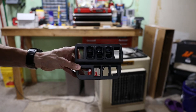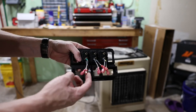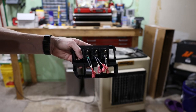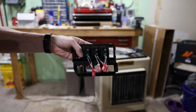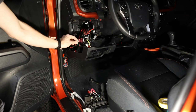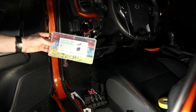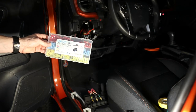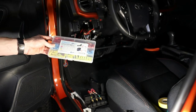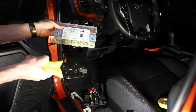After 30 minutes of dremeling, I was able to fit the switches in there, and that's what it looks like. While I'm at it, I went ahead and wired up some quick disconnects — that way I don't have to cut and splice if I need to remove it again. I got the quick disconnects wired up on the inside: this goes to the compressor, this goes to the ground. I snagged these on Amazon — 100 pieces in ranging gauge sizes. I can put a link to those and to the crimpers in the description if you're interested.